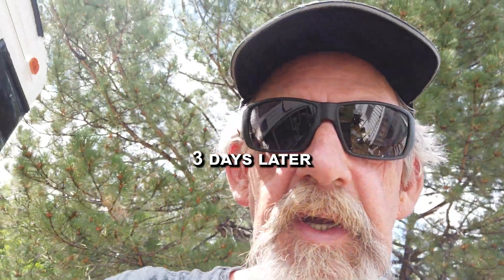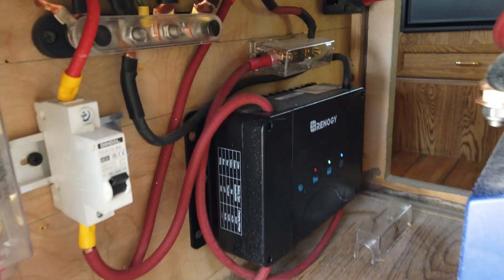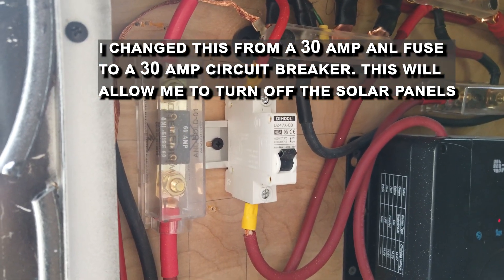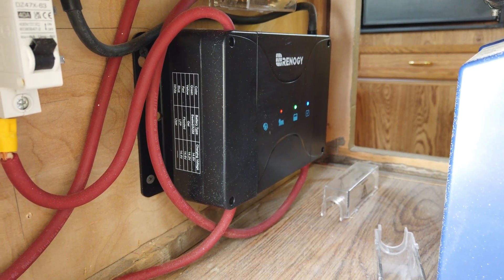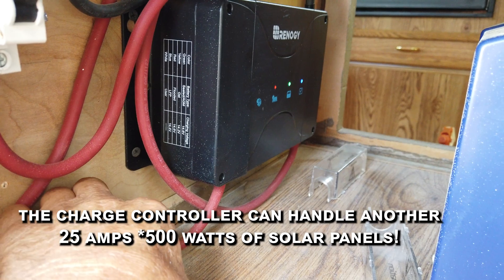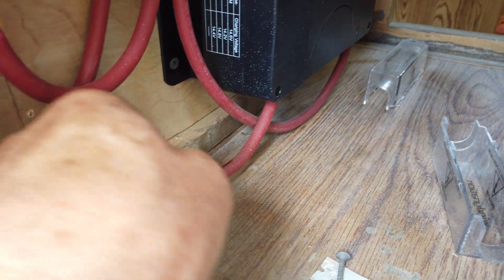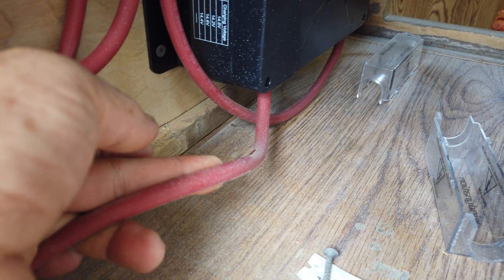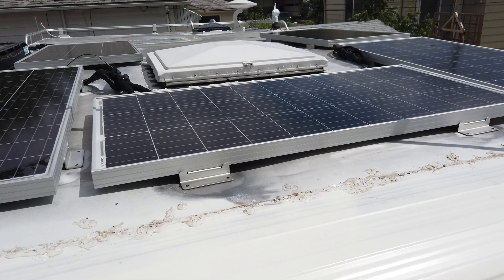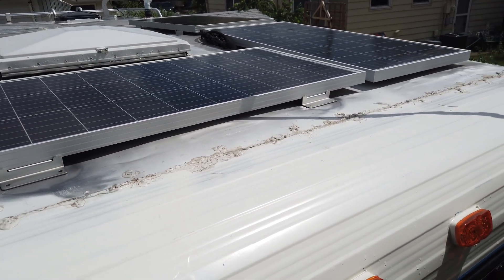We just came through a really intense rainstorm — we got half an inch of rain in 15 minutes here at my house. But we got the solar installed. Here's a quick tour: here's the electrical compartment. That circuit breaker there is a 30 amp — it protects the solar, which feeds over to the DC-to-DC charge controller. This is a 50 amp charge controller. It also has the ability to alternator charge from the vehicle — this line comes from the alternator on the vehicle. So that finishes up the solar.